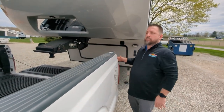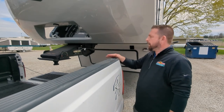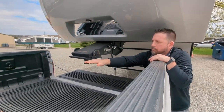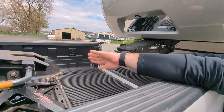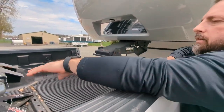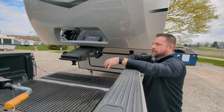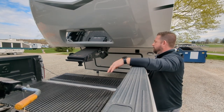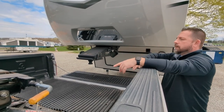I have it kind of pre-set up. You're going to get lined up with the Cougar — tailgate down already, which is obviously super important. What I like to do is start with the surface of the kingpin about an inch or so lower than the top surface of the hitch. When we back underneath it, you can see they're beveled and it's going to follow it down for a nice tight fit. If it's too high, the jaws can't come across the cutout in the kingpin and it may not latch properly. You could end up going too far back and tilting the head forward, and depending on the space, you could risk getting your tailgate into the door. So I always start about an inch lower than the top surface of the fifth wheel hitch itself.